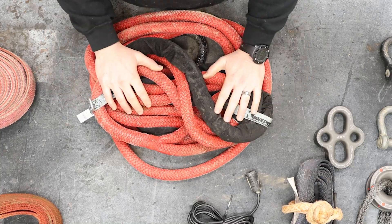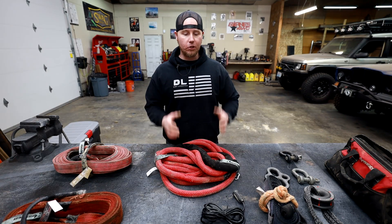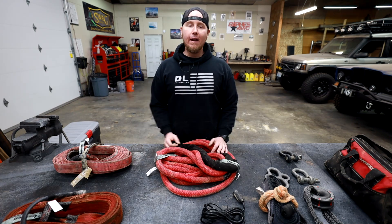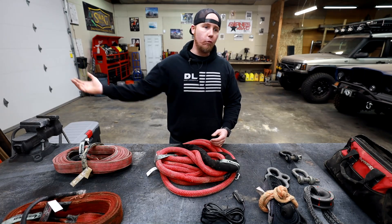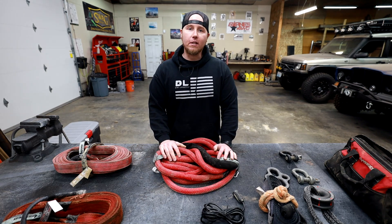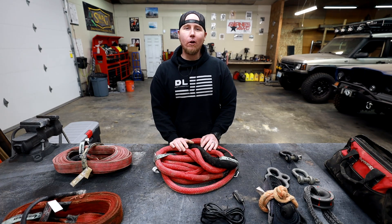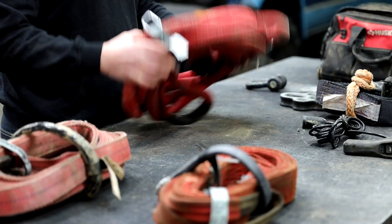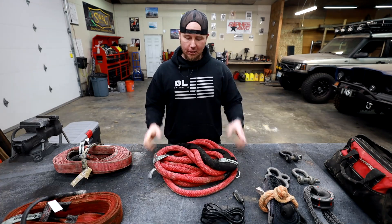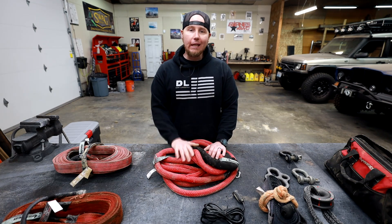This is a kinetic energy rope — probably my favorite piece of recovery gear besides a winch. I use this in snow and sand because you're not just using your engine to pull someone out, you're using your momentum. As the rope stretches it gains energy, and by the time it reaches that point where it can start to yank them out, it just softly zips them right out of the hole. When I first started wheeling 16 or 17 years ago there was nothing like this on the market. This is the very first Yankum Rope I bought about a year and a half ago and I've got 60 to 80 pulls on it and it still looks and functions outstanding. Save up the money and get a good one — I highly recommend Yankum Ropes.